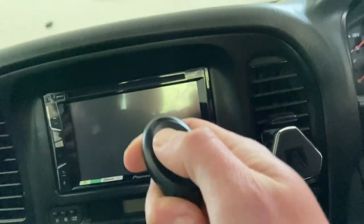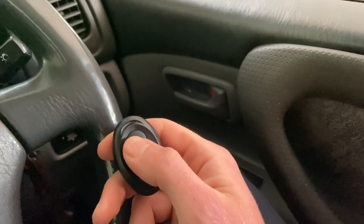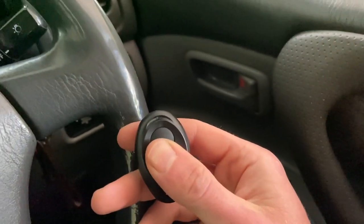The second time I finished within 10 seconds and the indicators started flashing, which meant it had successfully entered programming mode. The indicators will flash 20 times, and on the 20th flash you want to hit the button on your remote. The indicators should flash again to confirm a new remote has been entered. Then turn the key to the on position — apparently that saves the remote in the computer — and then back to lock.